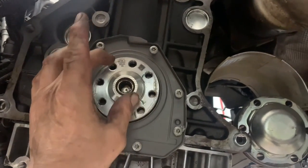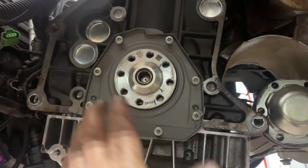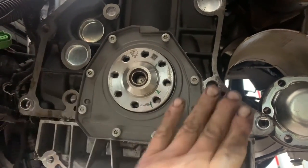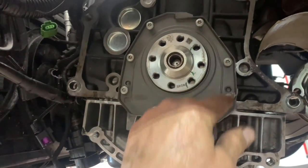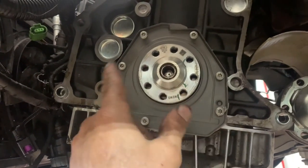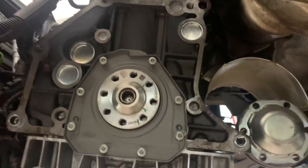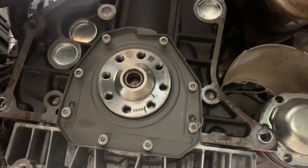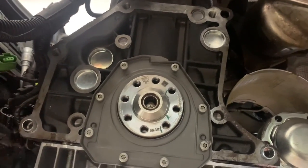Put some silicone inside the little grooves on your oil seal housing. Don't put it on too thick because you don't want to push it toward the seal — just a quarter-inch bead all the way around inside that groove. Then get it up here, line it up with your tool that's on the seal, eyeball the two holes, and with two hands push it on in one smooth motion. Get a couple of bolts started, get them all started, snug them up, then torque them to 10 foot-pounds. Let that dry — it should cure at least 24 hours.